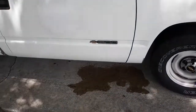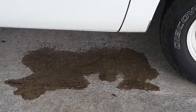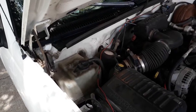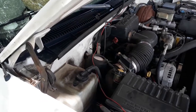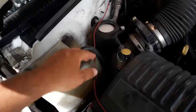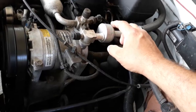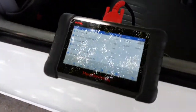All right, now you see that since we kicked up the fan speed, we got a lot more condensing happening here. A lot more water dripping out. So it's dripping out pretty well now. So that's it. That was the purpose of this video, to show that just because your AC is freezing up doesn't mean that you're low on Freon. Could be something else wrong too. But you want to see this nice sweat on the lines. Sweat is good. It means it's colder than the dew point outside, but you don't want it so cold that it's freezing. See, even I get condensation right here, but this would get frozen as well. It was so cold because it was not cycling, because the air wasn't flowing over fast enough. But that's it. Hope it helps.